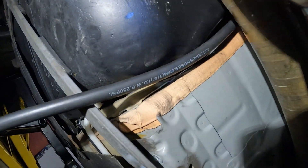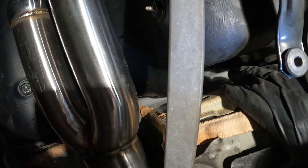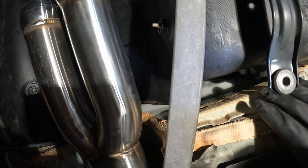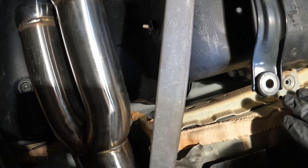It goes up and above. After you shove it there, just keep giving it some slack and pushing it. You want to try and get it to this hole here, which is right above the low pressure fuel pump. The idea is push it enough to get here, then stick your hand in — if you have a smaller hand it's going to be a lot easier. Stick your hand in here and just push it straight up like you're going to the back seat. The further you go, you'll kind of reach a certain stop, but just get it as high as you can so you can then get it from the top of the low pressure fuel pump. You can stick your hand under and almost grab it.